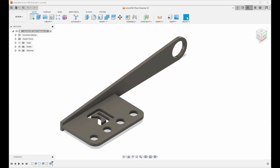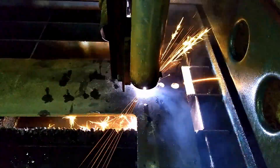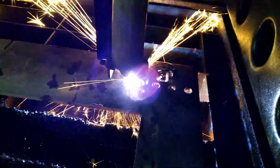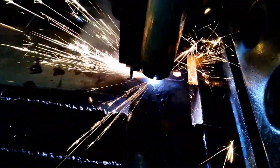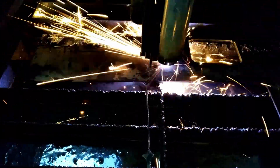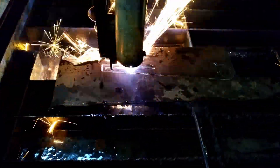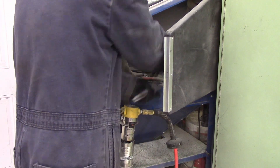This is the first time I've tried to design parts that key together, so that was kind of an interesting experience. And since I seem to be making a fair number of sway bars for this Hyundai Accent, I might as well make this easier on myself. So we plunk her down on the plasma cutter and we'll let her do her business. This is a Bailey 2x2 — it doesn't take up a whole lot of space, and it can use an ordinary handheld plasma cutter. We're using an old Hobart plasma cutter on this device.